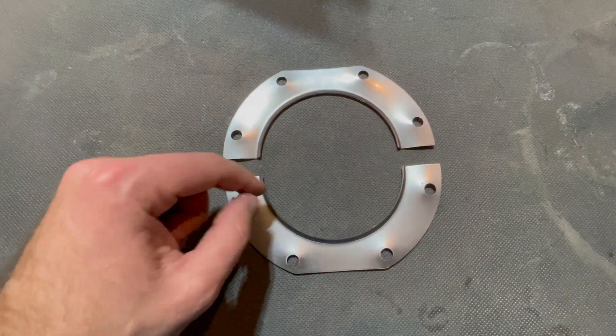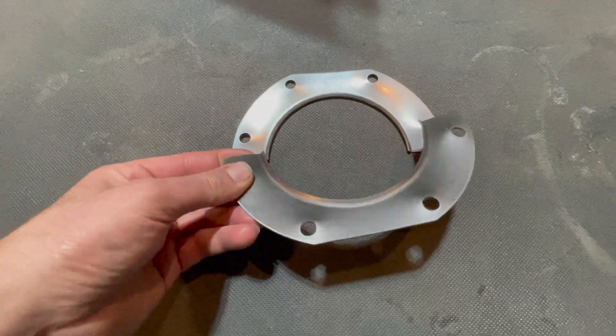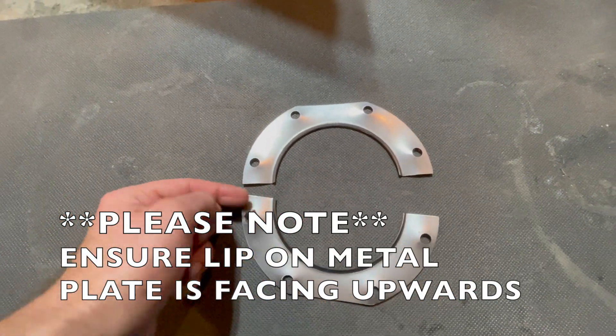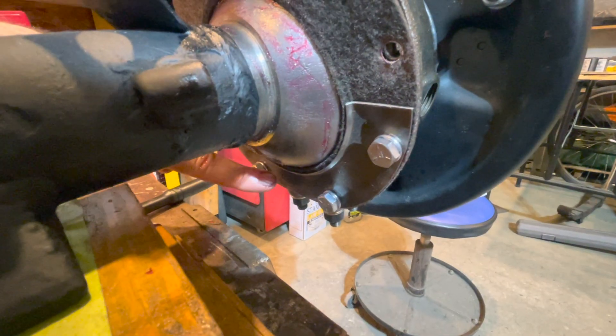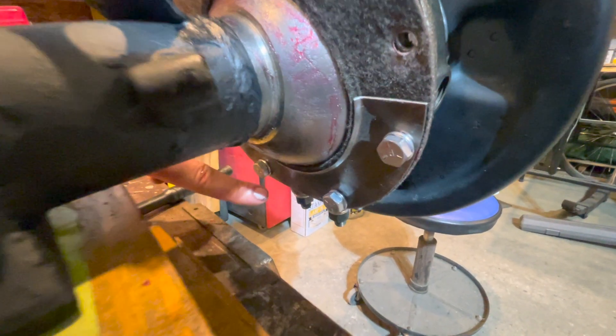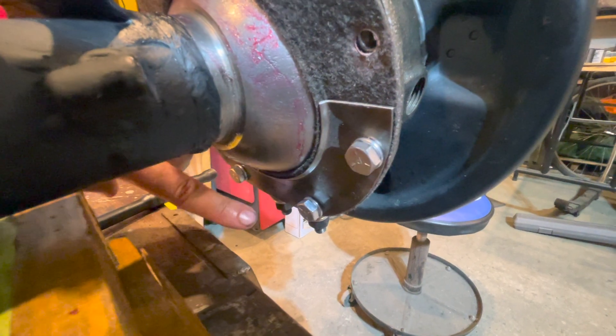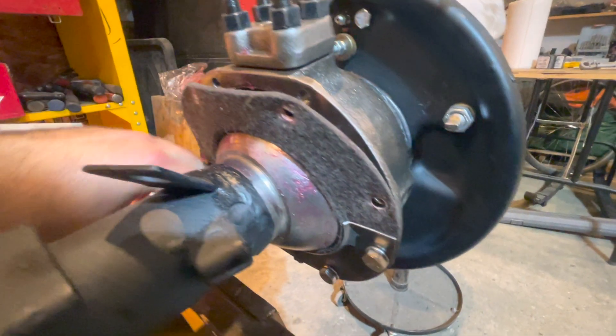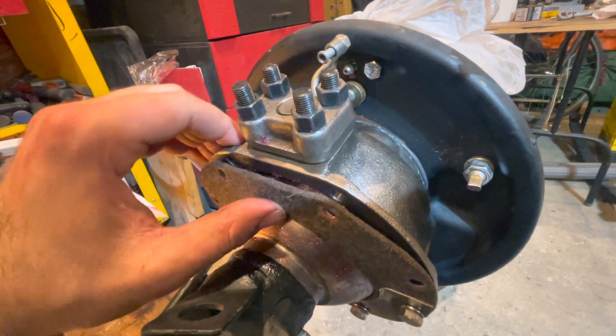One note with your metal plates: make sure you install your plate correctly. You see this small lip on your plate — make sure that is pointing upwards. Align your metal plate with the holes under the felt seal and start from the bottom, working around getting all the holes in. It's a bit tricky while pushing the rubber in. Now work on the top while pushing in the rubber and the felt seal.